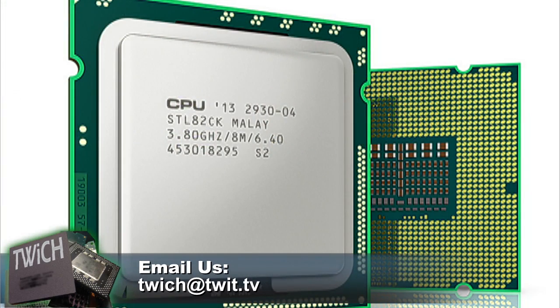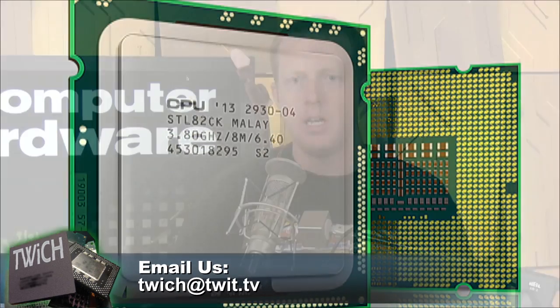Unless you have a specific need for ECC memory, you should get the 4790K because it's going to be quite a bit faster. It's going to be noticeably faster with that 500 megahertz frequency boost that is just free out of the box compared to that Xeon part. So the 4790K is the best mainstream consumer, high-end enthusiast part. If you don't get into the Sandy Bridge, Ivy Bridge, Haswell-E stuff that's coming out, the 4790K is the part to get for sure.